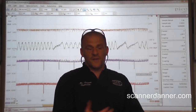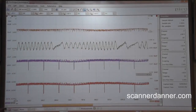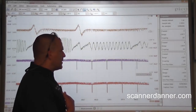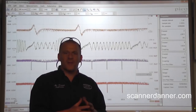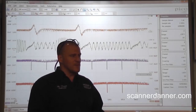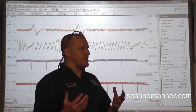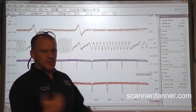The computer needs good cam and crank signals to fire the coils, and they're there. I don't know what exactly they're supposed to look like right now, but they're not there with the key off. Something that we didn't see during a crank is the frequencies changed within the coil firings — it's almost as if the computer is not even using these signals. These coils are still coordinated exactly together, which they should not be — we never want to fire both coils at the same time. So they're not firing properly. All of this noise in my signals is really suggesting a ground issue. I think the next direction for sure would be a ground issue based on the noise, based on these signals.